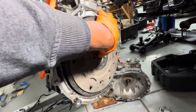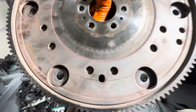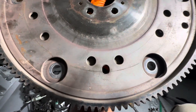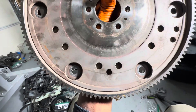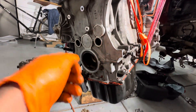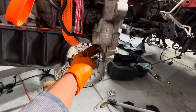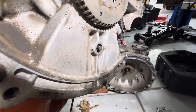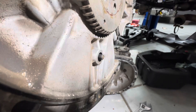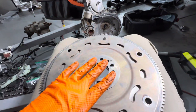I'm going to pop this off and show you what we're aiming for. So this is the back of our flywheel right here. You can see there's a bunch of holes, and down here at the bottom there's one that's not lined up with the rest of them, and it's also not circular — it's kind of oblong, and that is the one that you're aiming for. So on your engine, you would be spinning it with your pulley bolt or your harmonic balancer bolt, cranking that clockwise, trying to aim for that hole while also putting pressure on this at the same time to get that locked in place. When you start off it's kind of like this, and then you're feeling, feeling, and then when it's in the right position, that drops in like that. And that's how you lock this in place.